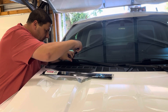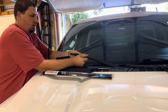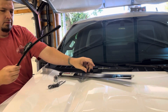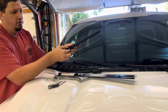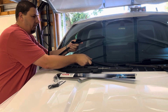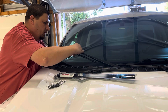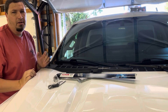So we're on the passenger side. Put your screwdriver in there, pop that tab open, slide that off, set it down gently. Open up your blade — same thing, squeeze the tabs on the side. That's for the Bosch Pure Vision. This squeeze tab may be a little different depending on what style wiper blade you get, but they're going to be similar. Lift your wiper blade up, hook the hook on the inside, snap it on, click it. There you go — it's that simple.